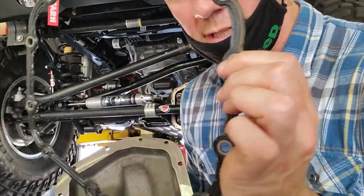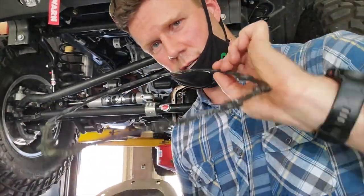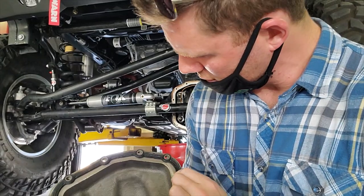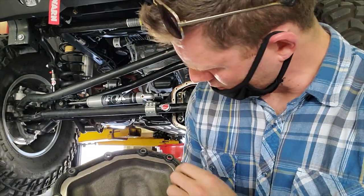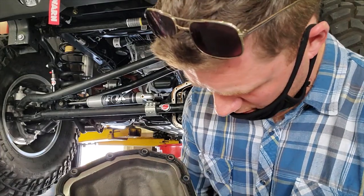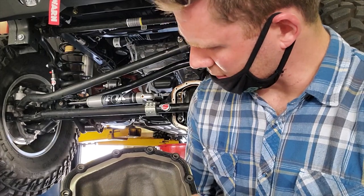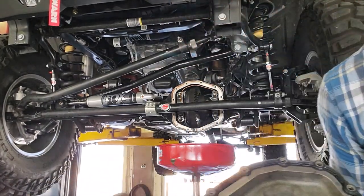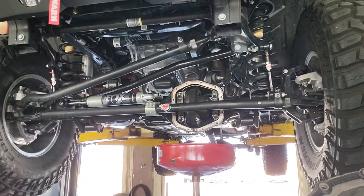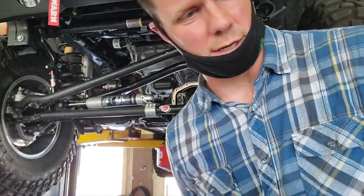For the install, I'm going to reuse the stock gasket — it's only got 2,000 miles on it in nine months and it's in great shape. You can also use RTV, but since these come with a locker gasket with a metal-encased gasket, I'm going to reuse the stock Jeep gasket to line everything up. Grab a couple of bolts — they do come with new hardware and they already have Loctite on them. If they don't, always use Loctite.